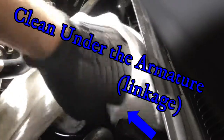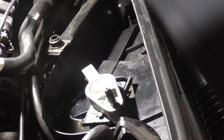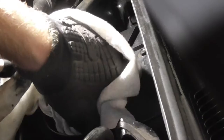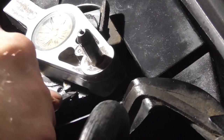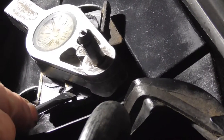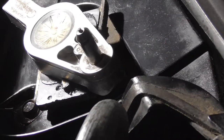When you lubricate, be sure not to over-lubricate with heavy grease, as that can make the rotor armature slip over the tab. What I am doing now with a simple screwdriver is making the tab a little more edgy and sharp so that the armature rotor can better grab it.